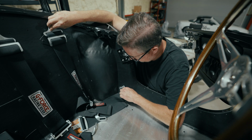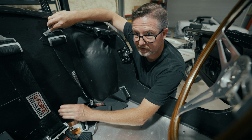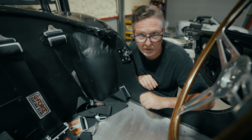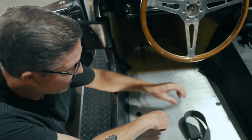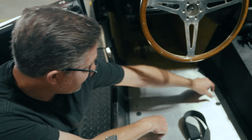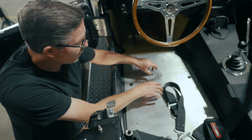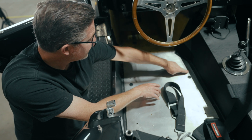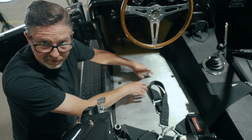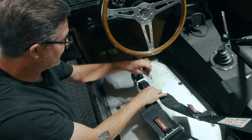So the rest of the seatbelt bolts are actually into hard steel mounts that are welded to the frame. So getting to one of these frame points is kind of paramount in this situation. One other thought we had was actually running a piece of steel bar between the 2 front seat bolts. The deal is with that, once again, we're only into kind of a lightly structural piece when what I really want to do is get into the frame of the vehicle itself. So that's our dead center spot.